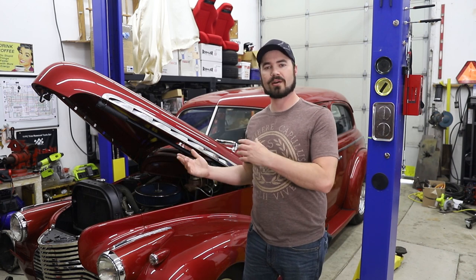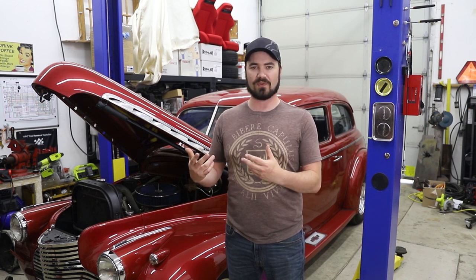If you've watched my previous video, you saw the wiring harness for the 1940s Chevy get made. Now, the car already had electric fans on it. The circuit for the electric fans was terrible. And what we discovered was that there had been a semi-correct circuit of wiring in the car, and then someone else had come along later and butchered it and put it in totally incorrectly. Essentially, we replaced all the bad wiring and added in a relay, but we reused the switch under the dash. Now what we're going to be doing is making it so the system can turn itself on.